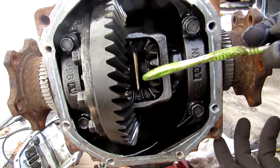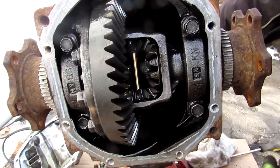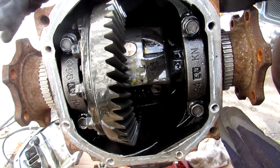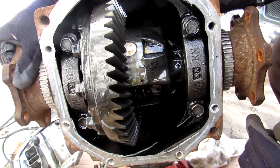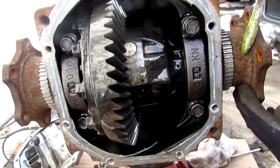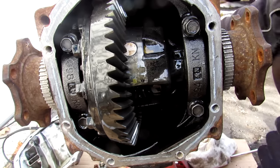There's also the locking differential for low speeds, which will completely lock all of these gears together, allowing them to rotate and get you out of a sticky situation. And then there's brake-actuated traction control, which will clamp the brake down on one side increasing its resistance. The energy will then come through to the wheel that has traction as its path of least resistance and get you out of that puddle.